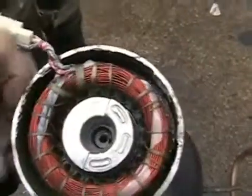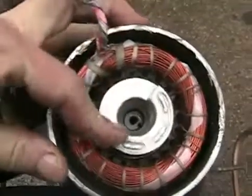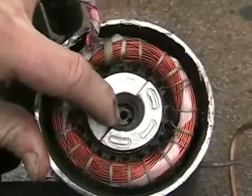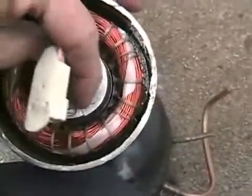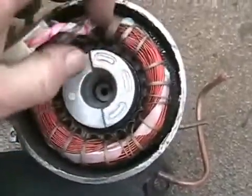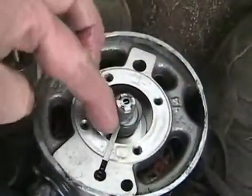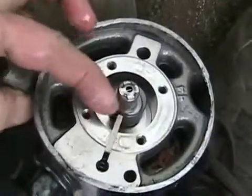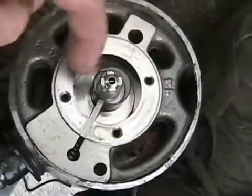If you flip the machine over, it's just a typical induction electric motor, which means it has no brushes, with a counterweight. The pressurized freon actually comes up through that hole, fills the whole top of the cavity with pressurized freon, and then blows out the output. Very ingenious design. You can see that little cylinder that rotates around, the vane popping out, and the offset machining on the crankshaft.